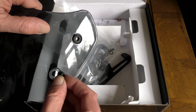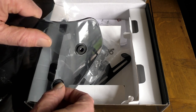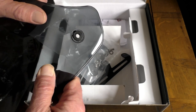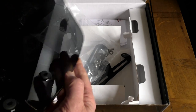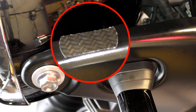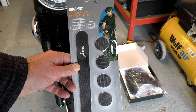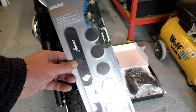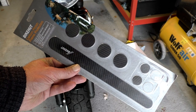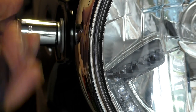The first thing you need to do before getting your hands dirty is put the little grommets into the screen — be careful because if you drop one it will bounce off into another dimension. Where those lugs are going to rest on your headlamp bracket, you need to put something there to protect it. I just cut some bicycle frame protectors to size — you can get these from any bike shop. They're just to protect bicycle frames from cables and chain. Stick them in the right place and they'll stop those lugs from damaging the paintwork on your headlamp bracket.